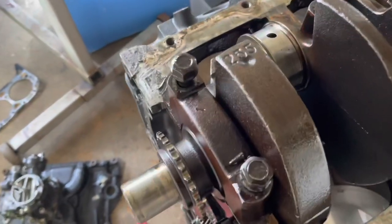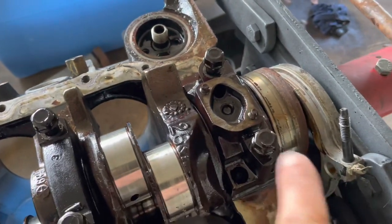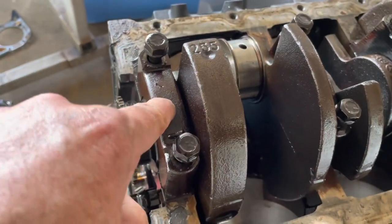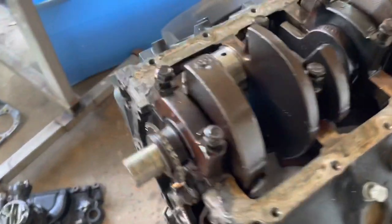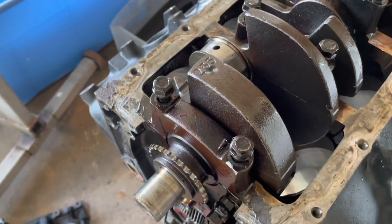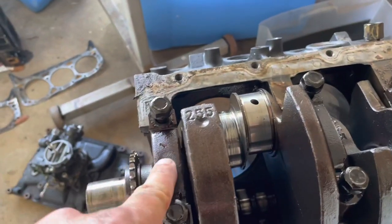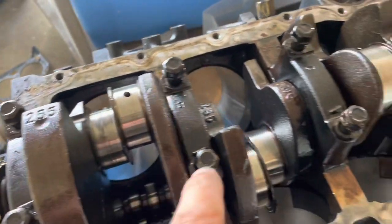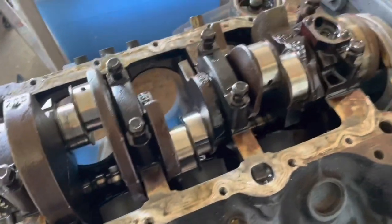You want to make sure your main caps are numbered - this is number one, number two, number three. On this 4.3 V6, number four is unique so you don't have to remember that one. But you've got to get these back on in the right place - this hole was machined with this cap in place, so the cap and the location are matched. Do not get those mixed up. I have mixed them up before and in that case you have to torque them down and look at the machining marks to try to figure out which one went where. If there's no number already, take a punch and put one dot here, two dots there - no dots on the unique one. That's how I do it.